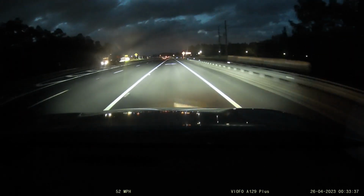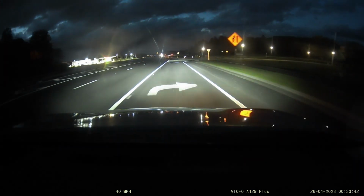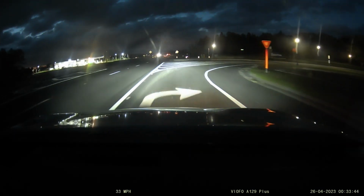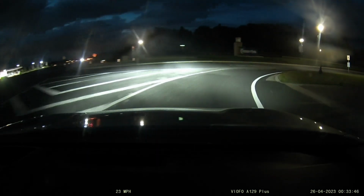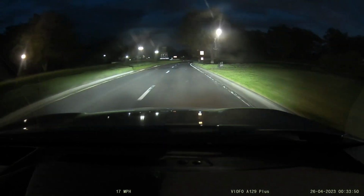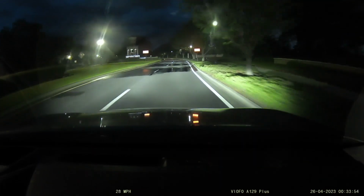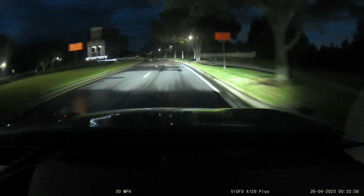This has high, medium, and low for those settings. And of course, lots of things affect what your best setting is going to be: where it's mounted, exactly how it's mounted, your suspension of the car, the tire pressure. I mean, everything comes into play. So if you find yourself getting false locks, you definitely want to just turn that down. So it's always good to have that feature.